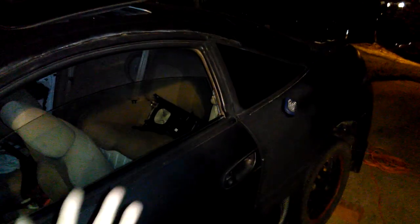But for this car, like most sport cars, it's easy to do because you don't have to drop down the gas tank. But with other cars like trucks, it's a pain. You have to take down the gas tank to get to the fuel pump. So for a sport car, that's why it's sporty. It might be a narrow place to work, but at least it's on top of the gas tank where you can take out the fuel pump and replace it that way. But that's just the worst case, okay?